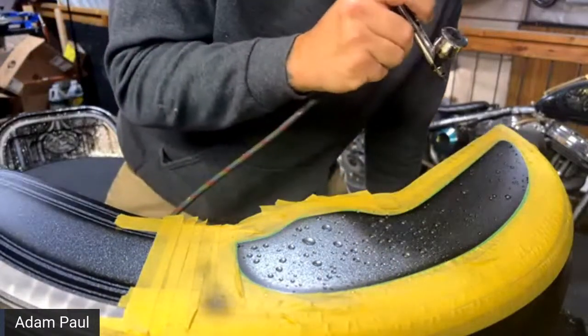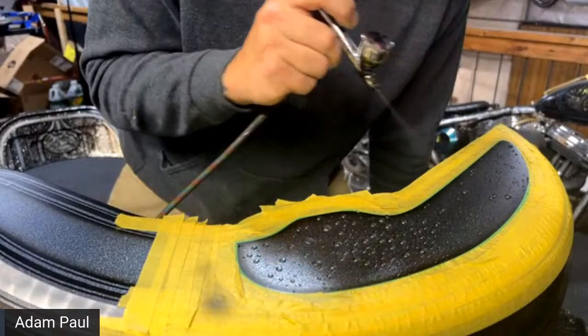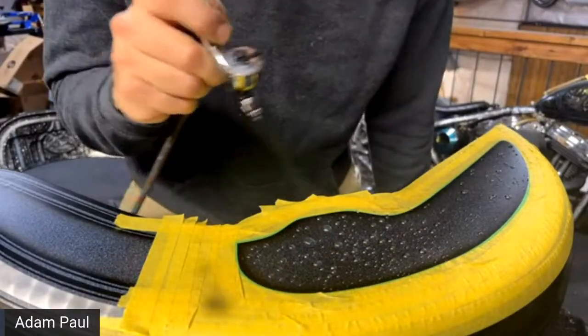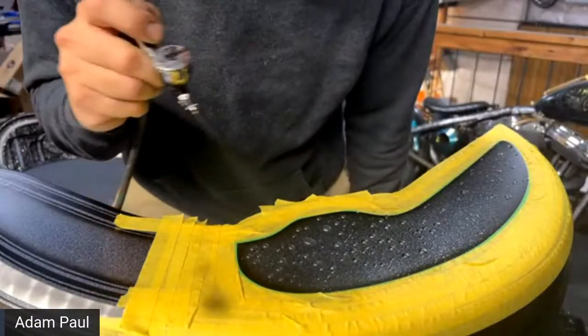And someone said, have you used the Lime Line gun to paint base and clear? Yes, I use that Lime Line 1.3 gun for everything. I haven't used it for my primer. I just reduced my primer out a little more. Makes it easier to sand anyways.